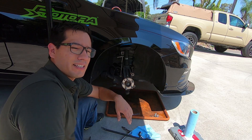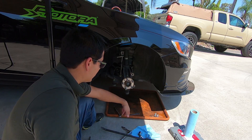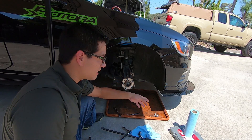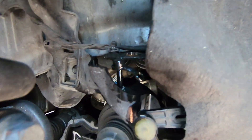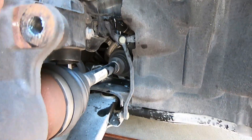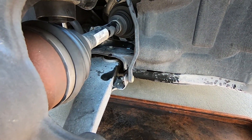If you remember on my last video, I was saying to do the brake lines last. Well, actually, if you have a little stopper to cap it off, you can do them first. I did it first this time and capped them off. Right there you can see a nice little rubber cap up top to stop the brake fluid from gushing out — definitely helps. You're going to get a little bit of drippage when you're unbolting it, so use a drip pan and spray everything off with some brake cleaner.